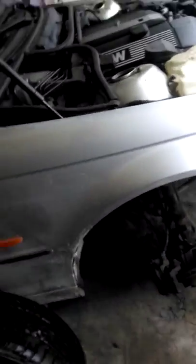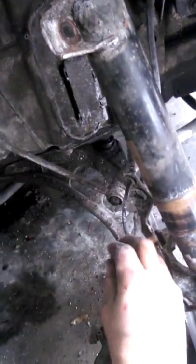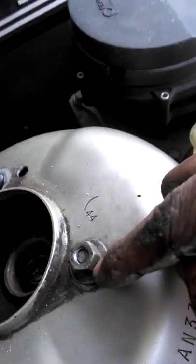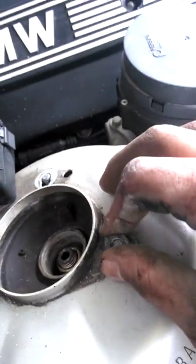For the front suspension, do the same process to take off the tire. There's a bolt right here — it's number 18 — and it goes all the way through. That will release this piece here. Then there are three bolts right here, these are number 13: 1, 2, and 3. I already released two of them, and you don't want to release these until the end.